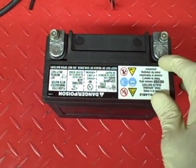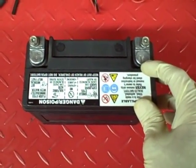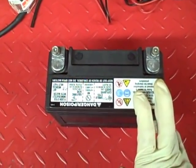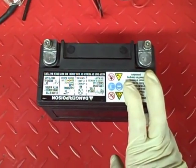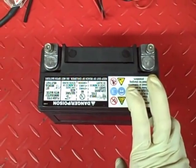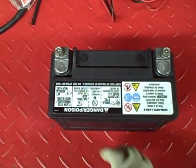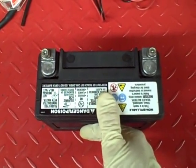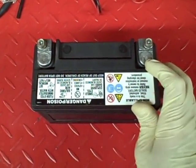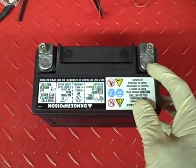From personal experience with motorcycle batteries, I never charge over two amps, because going any higher I've seen the batteries heat up. You don't want the battery to get warm while you're charging it — you want to periodically check it. Battery heating up can warp the plates and ruin the battery, and it also causes a conventional battery to gas. So I always stay around two amps.